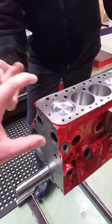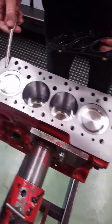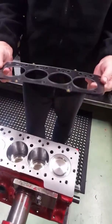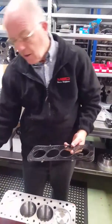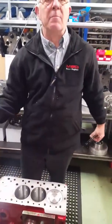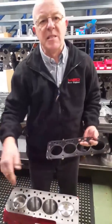Something like that, but more rubbery. What you'll see now is all the holes we were talking about — thirteen holes need to be plugged if you don't use this gasket. So the easy way is to use this gasket. And supposedly that's reversible as well, because you can still use the engine as a non-dry-decked engine. If you want to convert back: core plug back in, plug in the head, take that out, conventional gasket — back to square one. And that's a cheaper way of doing it as well. These gaskets are expensive, but doing all that machining and facing the block and facing the head, it's expensive anyway.